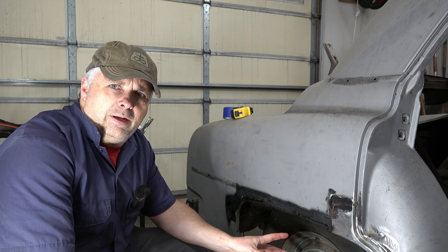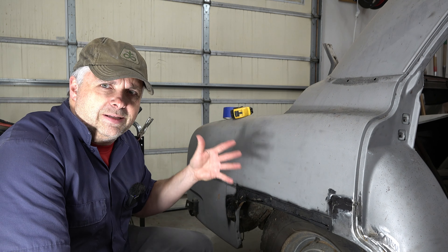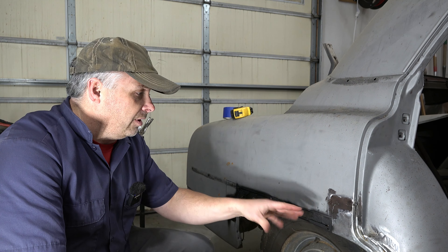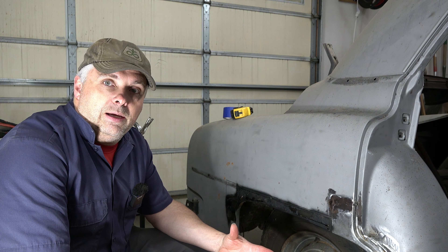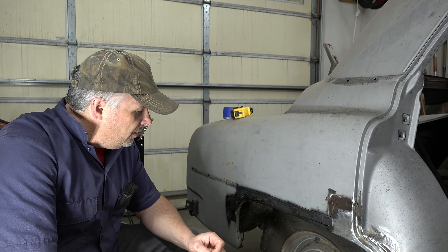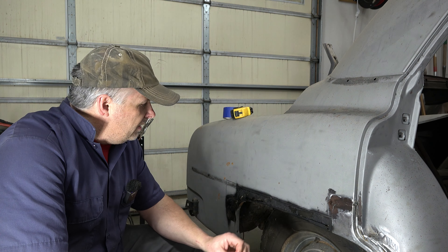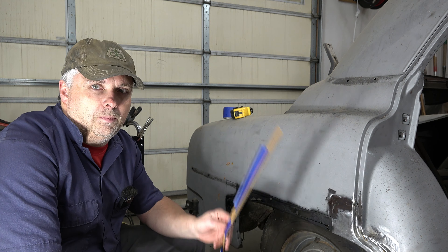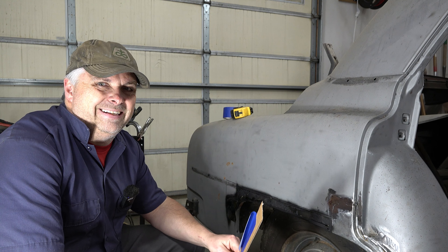I did not feel like doing an entire quarter replacement — it's not worth it. The inner rust I'm just leaving and putting some rust encapsulator behind it and in front of it to kind of stop or slow down what's already there. Now, this high-tech CAD stuff we're using? Yes, the highest technology available: cardboard-aided design.